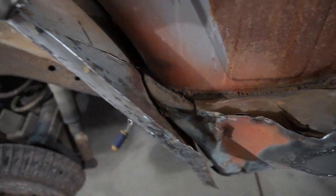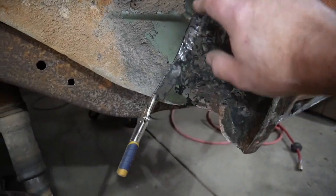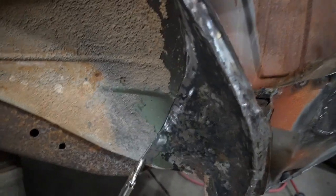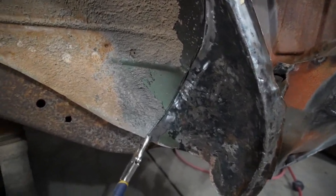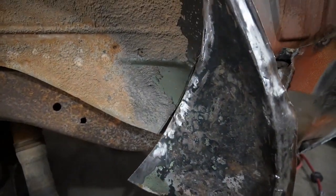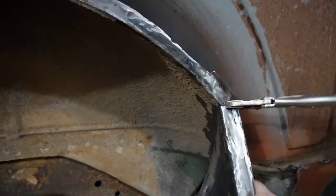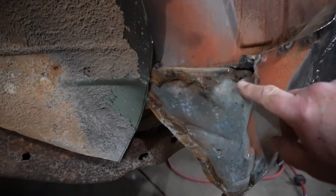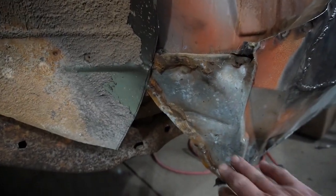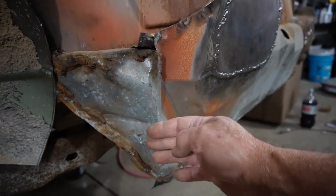So while we wait for that, by the way, I did take this piece off, actually sliced this panel here, took this chunk off in order to smash out all the foil looking dents. So I pulled that off, and I'll show you what's behind it if I can get these off. Gotta be smarter than the vice grips. Okay, this panel that goes around here will have just a couple of spot welds holding that on in here. This is all caved in, so that's why that's smashed back, and this is smashed in, so this should actually come out to a corner out in here.